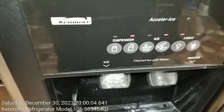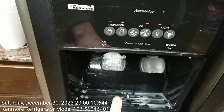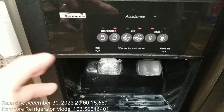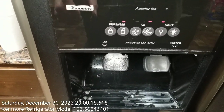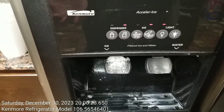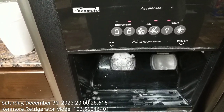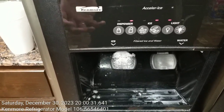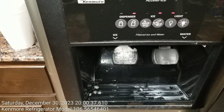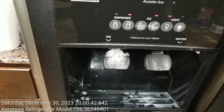What that does is it clears out the passageway between the ice bucket inside the freezer and the exit point of the dispenser. Because you don't have little chunks of crushed ice in there, the large whole pieces of ice don't tend to thaw and then refreeze into a giant iceberg in the passageway that you'd have to clear out by removing the ice bucket and using a knife, chopstick, or fork.